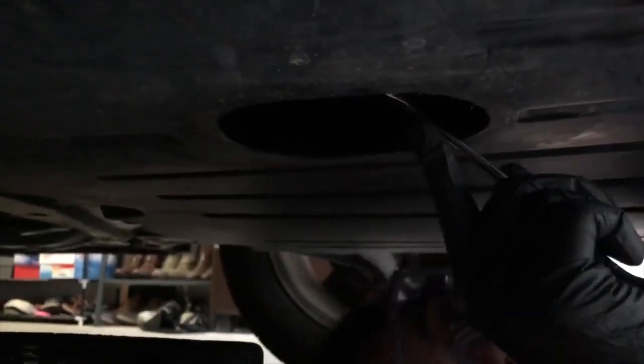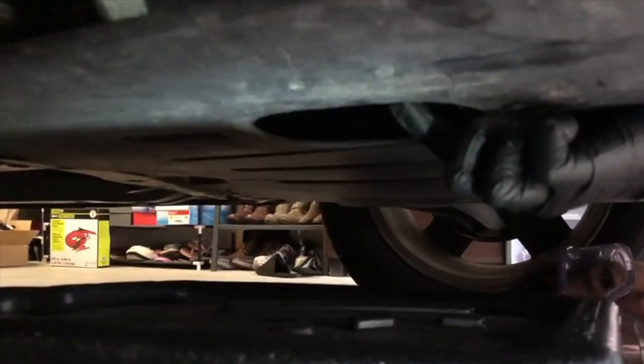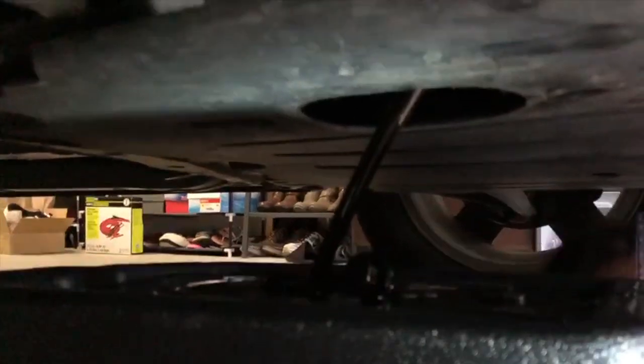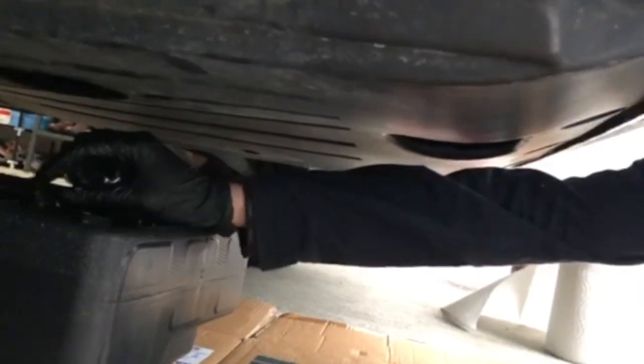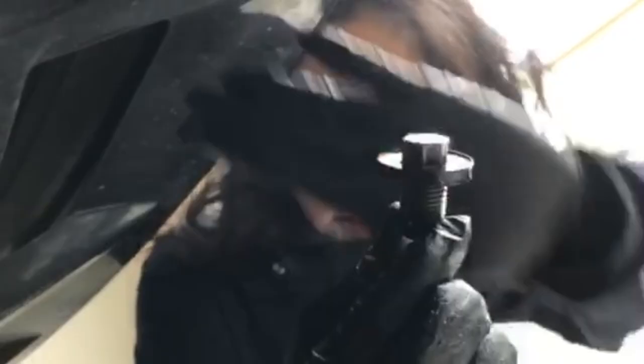It's loose! It's got a lot of threads. I'll make sure I don't tilt it so the oil doesn't go in my mouth. Look at that — laminar flow! It's actually black. So now you're just waiting for the last few drops to drop. Grab your bolt and use a paper towel to clean it before you put it back in. I'm also going to try to clean the mouth of the drain before reinserting.